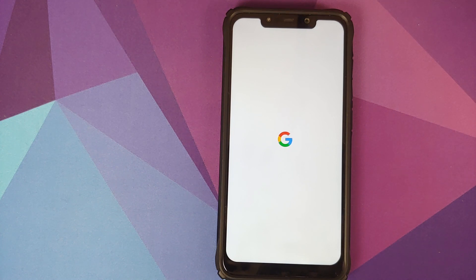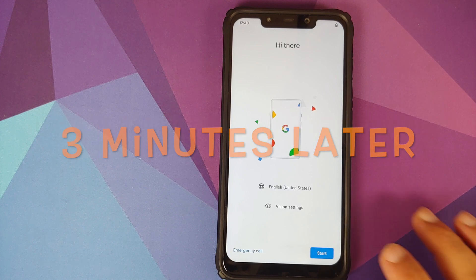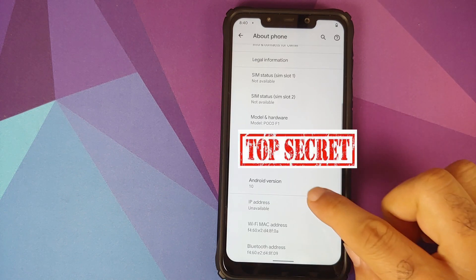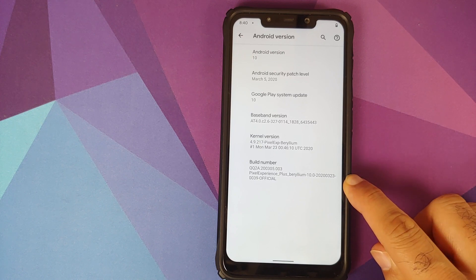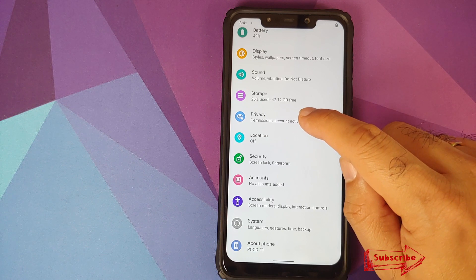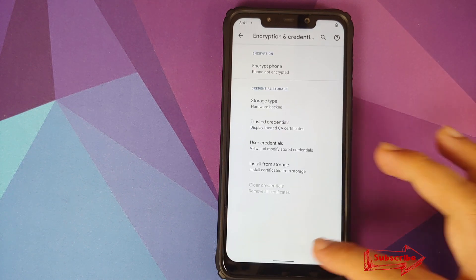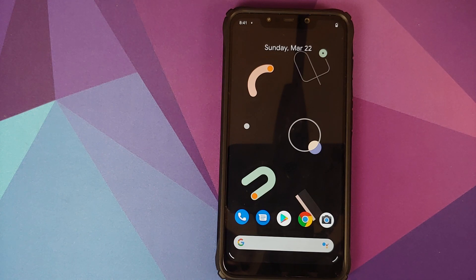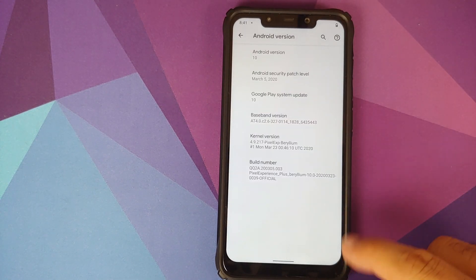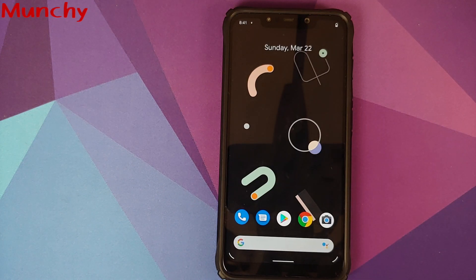We now have the Pixel Experience boot animation on our Poco F1, which means the device is booting into Pixel Experience Plus Edition based on Android 10. The first boot will take some time, so be patient. Once on the setup screen, skip the initial setup. Go into Settings, then About Phone — clicking on Android Version confirms we are running the official build of Pixel Experience Plus Edition based on Android 10 on the Xiaomi Poco F1. We can also verify encryption: go into Settings, Security, Encryption and Credentials — it says 'phone not encrypted,' confirming that Disable Force Encryption was flashed successfully. That's how you install Pixel Experience Plus Edition ROM on your Xiaomi Poco F1. Likes, shares, and subscribes are appreciated — feedback and comments are more than welcome.